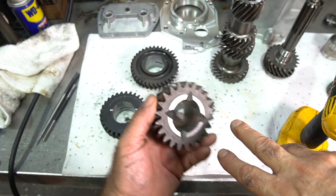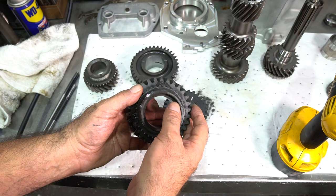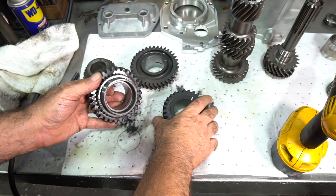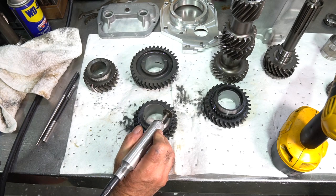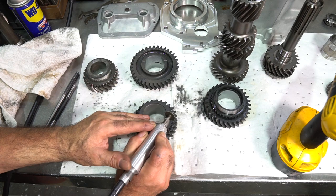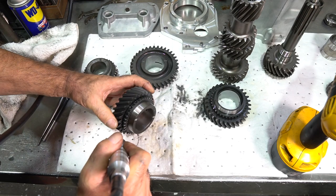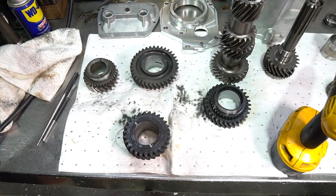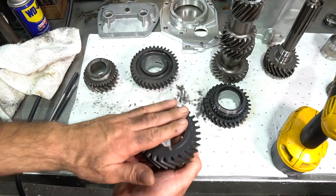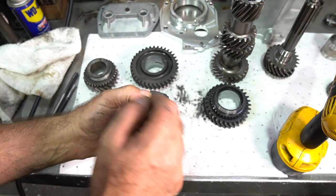On the second gear there's not really any thrust surface, so that's okay — there's enough oil there. On the third speed gear we'll do the same thing — put some notches in the cone area, because this is going to thrust right against the hub and we don't want it locking up on the hub for any reason. Just like the gears, the cone surface is very important as well. You might find some cones that get banged up or dinged up, so you might have to take a file or an abrasive stone and clean up the cones if they're rough or have a nick in them.